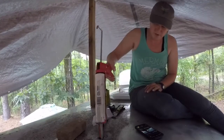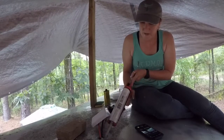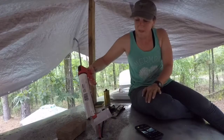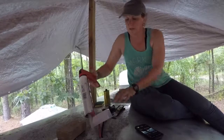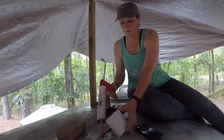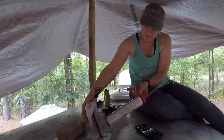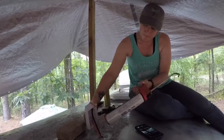There were originally three or four holes that were holding that little patch in, so I'm going to seal those up. I'm going to put a little Trempro on there. You can never have too much of anything that is keeping water out of your vintage trailer. So I'm going to go ahead and go all the way around there — I'm big on overkill. I really don't want to have to pull all this apart and repair it one day. The wires don't totally fill up the grommet, so I will go in from the inside and fill it to seal that up. I'm going to do a bead of it around. I can't do this with my left hand — I'm good with my right but not worth a dime with my left.